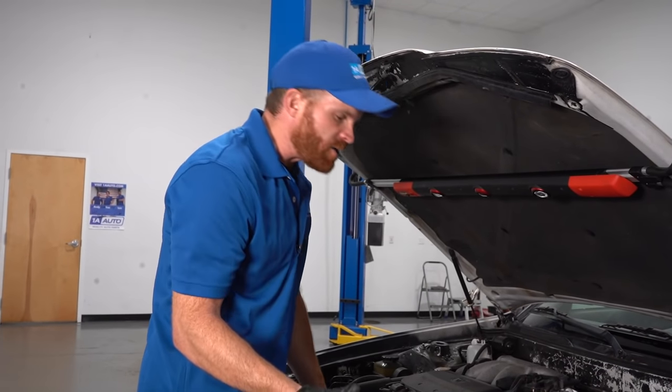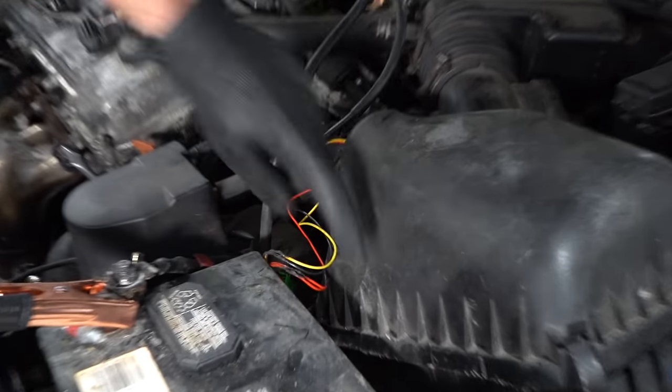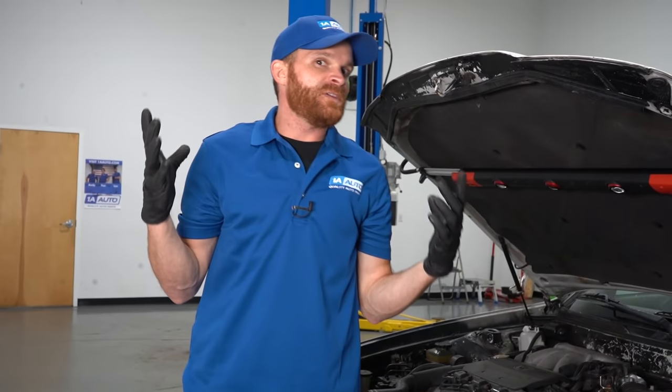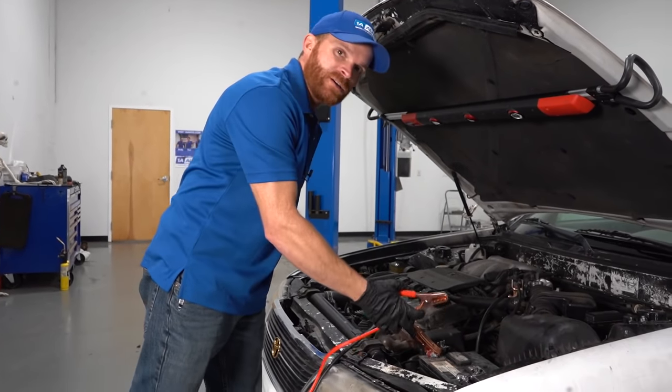Why might this be? Maybe something happened and you just blew a little fuse down the line. So maybe you hopped inside your vehicle and tried to start it up and it didn't want to start — the first thing I'd check is the fuses. Maybe you melted some of your wiring. You look around, get a whiff of something in the air, start tugging on some wiring and find melted wires — not good. Or something even worse and more costly: you could have potentially caused damage to your PCM, ECU, or even the transmission control unit.